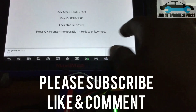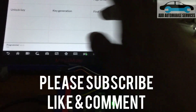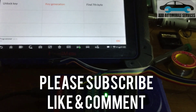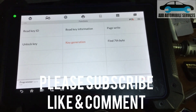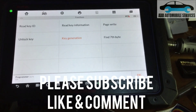You can see the key ID — it is the same key ID written in the key, and the key lock status is Locked. That means all I need to do is go and program the key to it with the dump. I'll also connect it to the PC and read it.